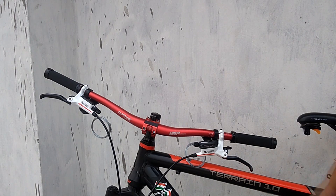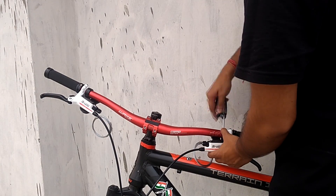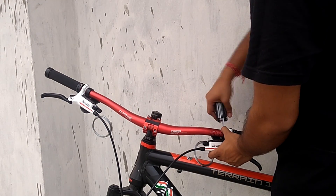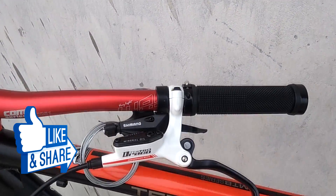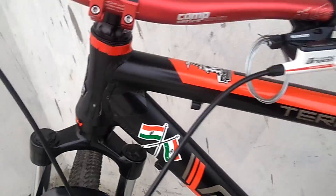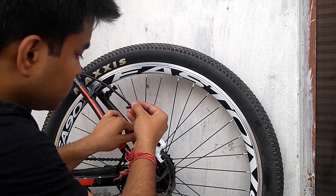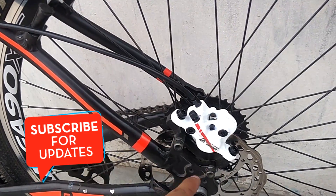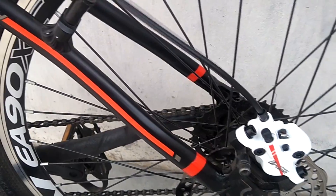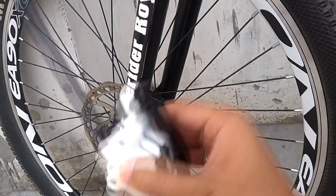Let's quickly position the brake calipers and the shifters. Both the brake levers and shifters are in position now, and we'll go ahead and attach these calipers to the disc rotors. I just upgraded my rear brake caliper from a mechanical one to the hydraulic one. I'll just route the brake wires accordingly, and now for the front one we will be installing this.